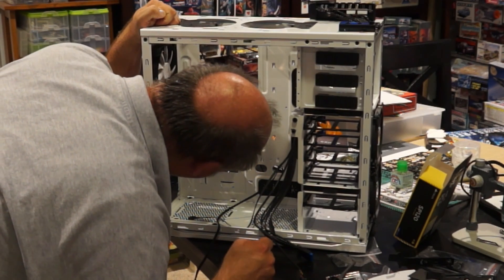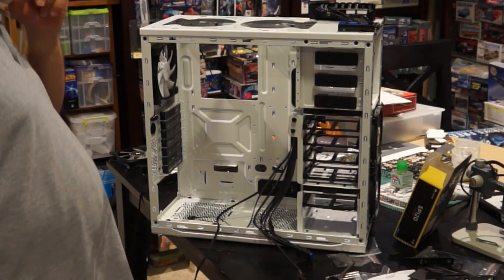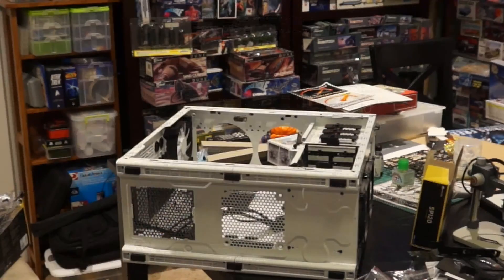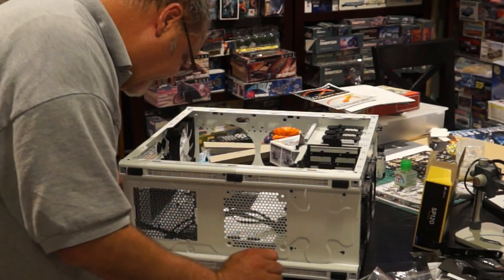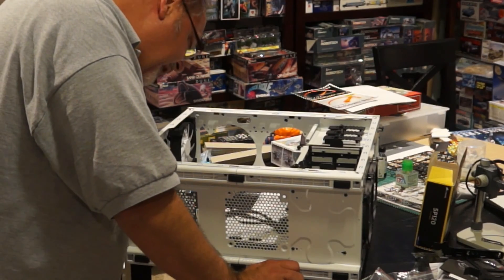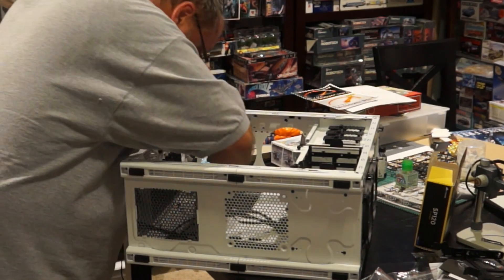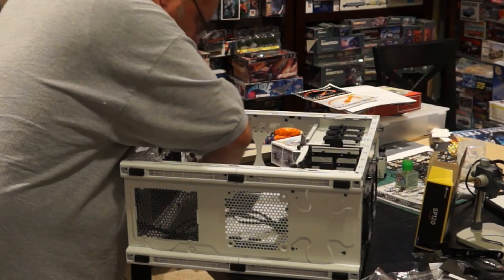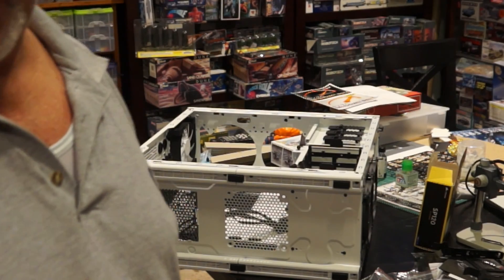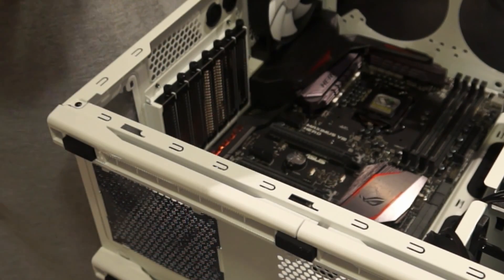I'm going to put the screws in, check them, then tighten them down to make sure they're going in properly. I figured out the listing: it's A1 through A9 for ATX, and B1 through B4 for Mini ITX. There are nine screws for an ATX motherboard numbered sequentially one through nine with an 'A' beside them. It took me a little while to figure that out. The case labeling was correct - those are the proper plate locations for placing the motherboard screws.